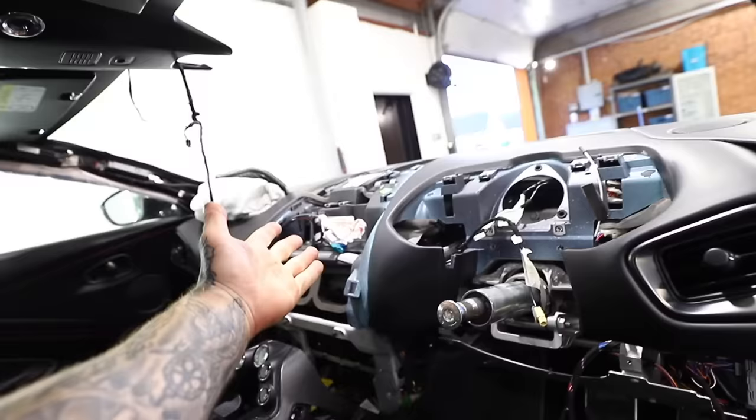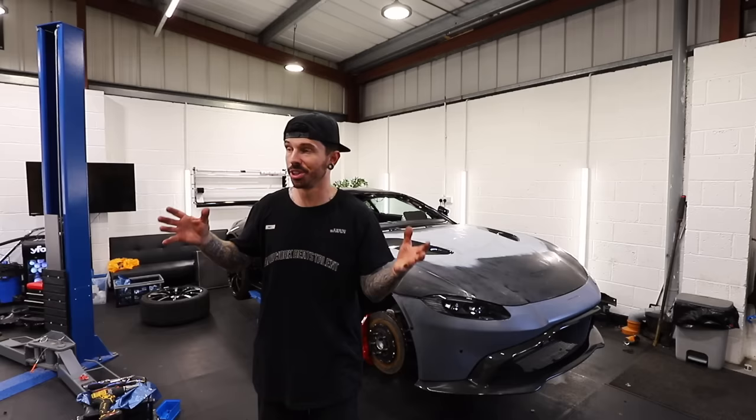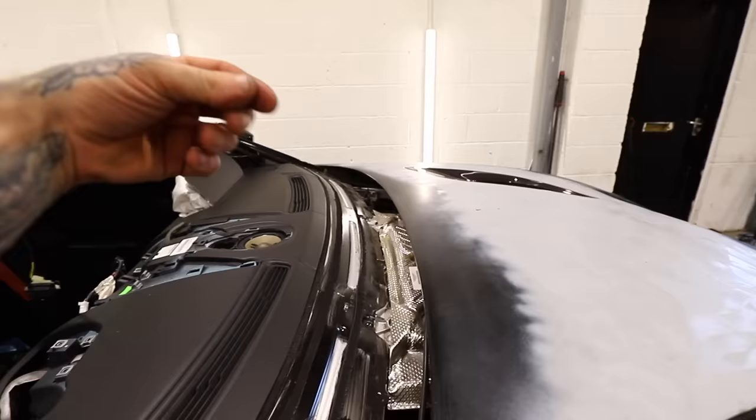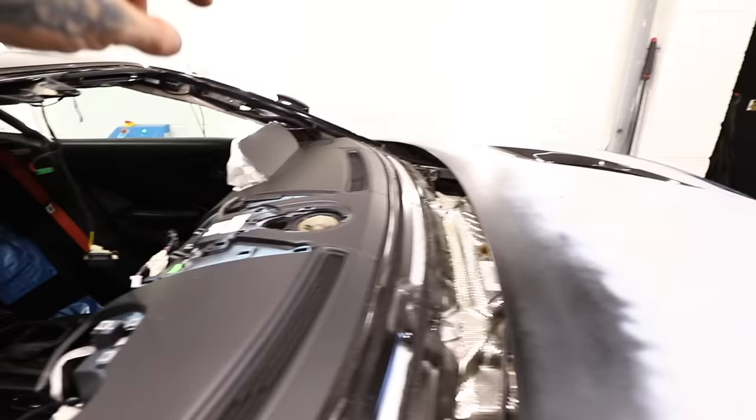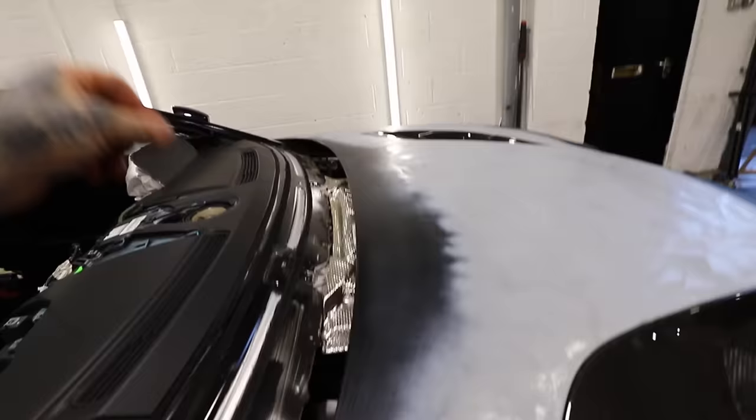That also explains why I haven't filled the cooling yet. Thanks to DTV Motorsport, an ex-Aston Martin technician came down to show me how the dash comes out — turns out I'm not far off, but I've dismantled things I didn't need to. Aston Martin are right: the full 50 kg aluminium frame must come out, no shortcuts. The heater matrix pipes, which run on coolant from the engine bay into the dashboard, must be disconnected to remove the dash — meaning if I top up coolant now, it'll go everywhere and cause airlocks. So coolant fill and dashboard removal happen together in the next video.